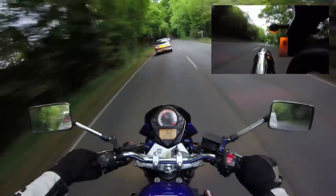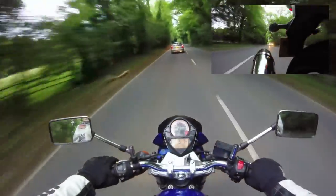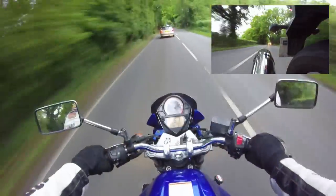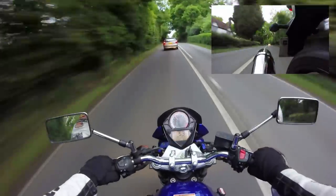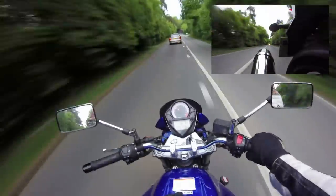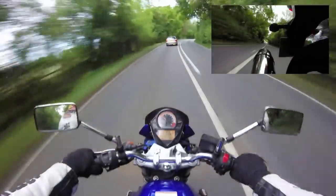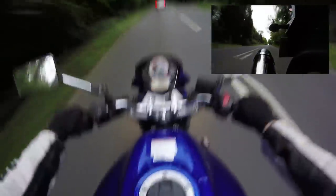Let's get that torque going again. God, I can never get tired of that engine sound. This is a very small bike with a small engine, but I could afford to be lazy there. If I was on a 600 inline four, that would have to be a change down maybe, or a much longer overtake — it wouldn't have been as pleasant. Now, if you're going to use this as a distance bike, it's not bad, actually. At 70 miles an hour the engine's still relatively relaxed — it's about 5,500 RPM. You've got the nice purring sound of the engine if you've got a decent exhaust, which I must add is an absolute essential. It completely transforms the bike.